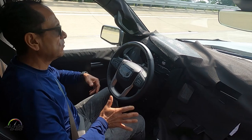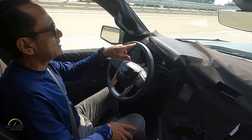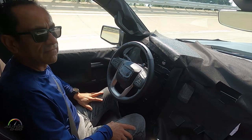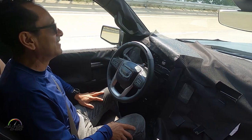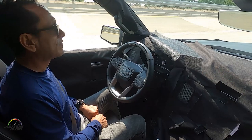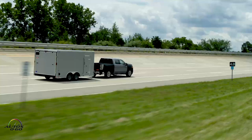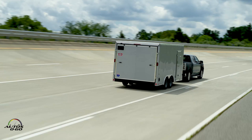It's amazing how fast you get used to that baseline of new things. So this system still has the cameras here, and it's looking at me. If I keep looking at you, will it turn off? Not really. We encourage the driver to always be actively looking at the road. I know, but that's one of the features, right? Because that's the safety. We call it a driver training tool. We want to train the driver that they need to always be paying attention to the road. There are timers associated with that, depending on how long you're looking away versus how often you're looking at the road. And the camera itself is actually down here. We do have emitters inside the steering wheel to illuminate in IR, so if it's nighttime, the camera can still see.